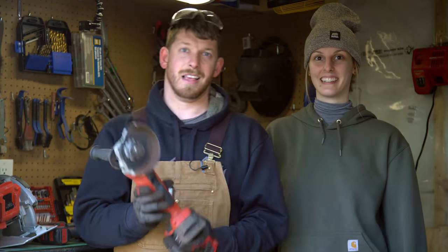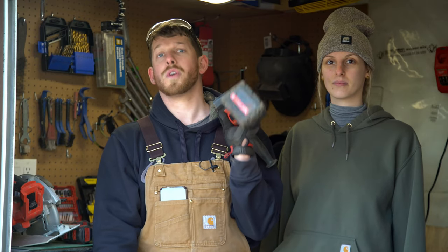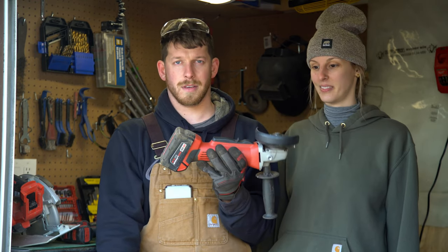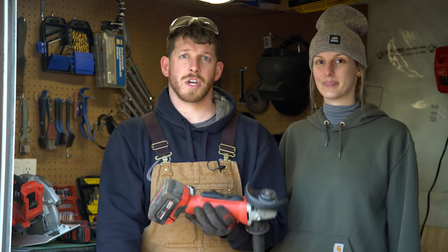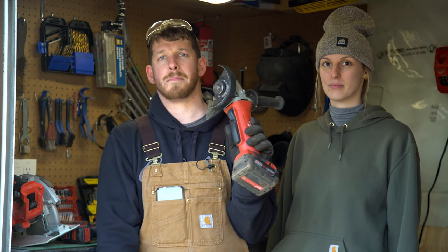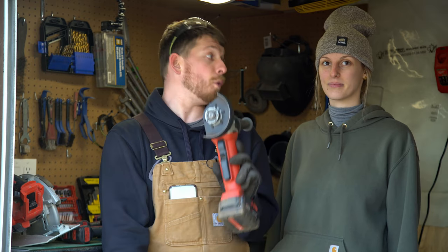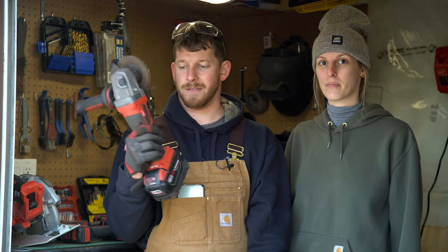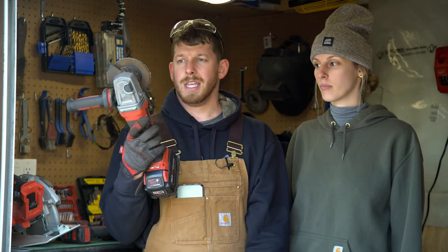So when you first get your bus, the obvious thing to do is to take out the seats. The most important tool for that is going to be a grinder. I recommend a corded grinder, not a cordless. We went with cordless grinders and we've gone through a lot of batteries — it actually slowed us down a lot, having to wait for batteries to charge constantly. If you do end up getting a cordless grinder, don't go with the cheapest in that brand's lineup. We did, and this is our fourth grinder — we've melted three. We've now gone with a brushless version; it's a bit more expensive but runs a lot better, especially if you're cutting and grinding a lot.